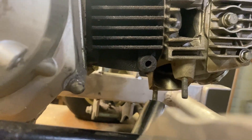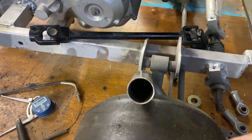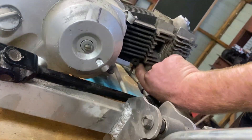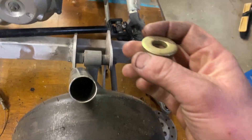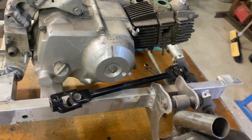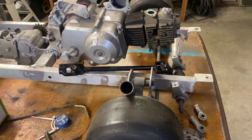It does need a bit of a flat to go against the exhaust gasket we put in there, and pipe being pipe it's a bit thin there. The inside diameter of that is obviously way too big for the little 110, so we'll measure it up — the actual inside port size. I'm machining down a washer, just sizing the inside diameter of that out to match. Sit it up in there, TIG weld that to that, just so it gives a bit more face around here — the seal on the gasket up inside the head. Not going for performance, it is only a little 110 for the kids to muck around on. But that's how we'll seal her off, that's where we're gonna start.